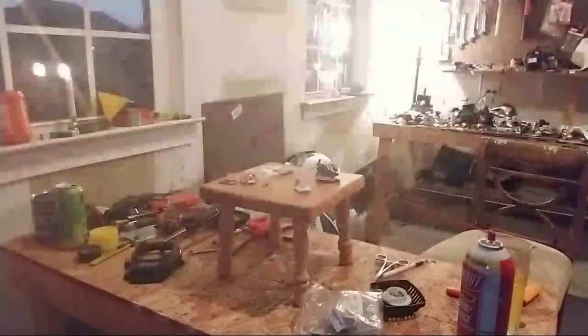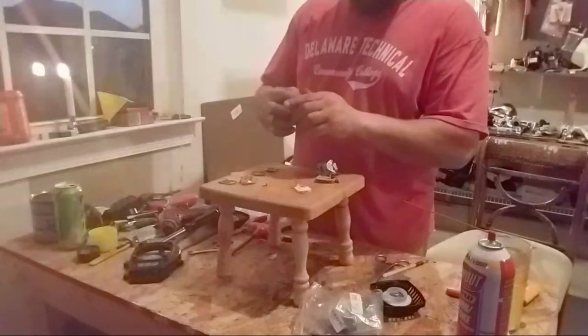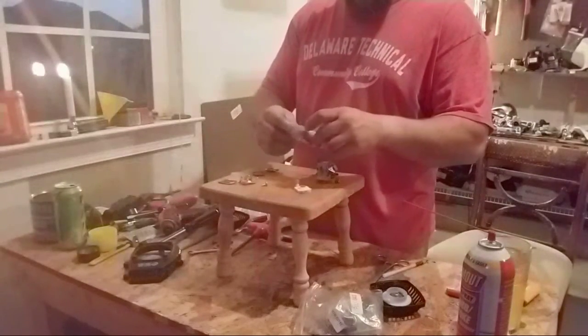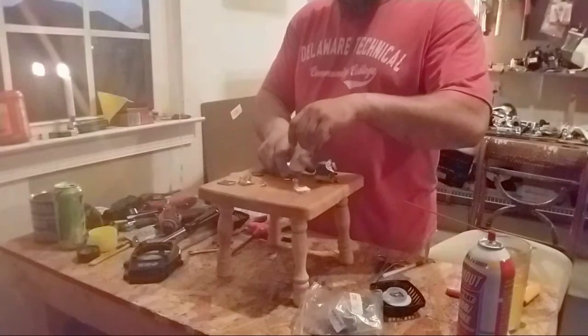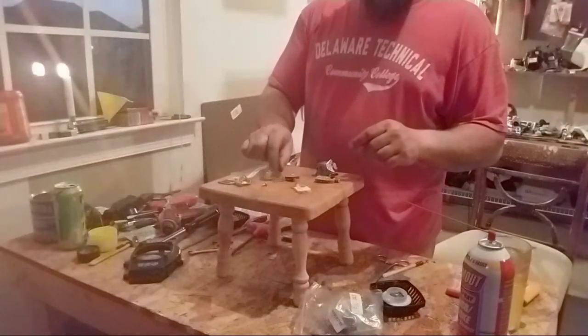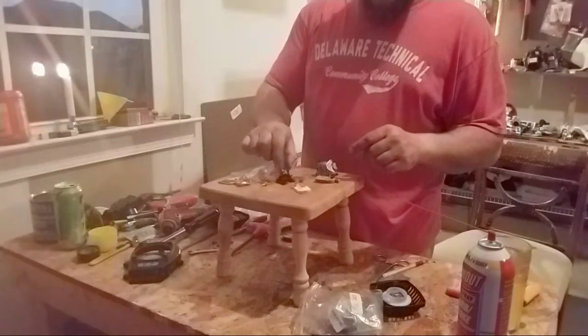All right, my bad. The connection, whatever. Got that much battery anyway. Make sure when you use your air compressor, you use about 20 pounds of pressure, PSI, because you will blow your stuff all over the place. Your little screens will come out.